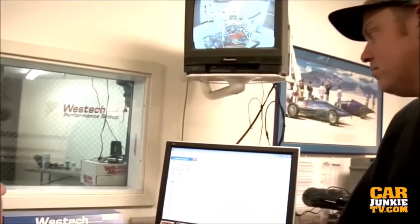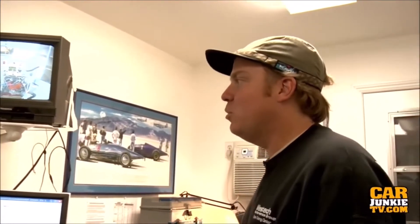If you're trying to build the ultimate looks-like-a-stocker combo where nobody's going to know you've modified anything, the original performer RPM with our milled down plenum divider is the way to go. Put the factory fill tube in the front painted orange, put 283 valve covers on it, and we'll be heroes.